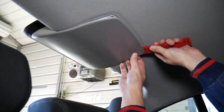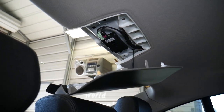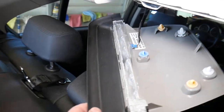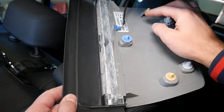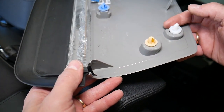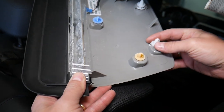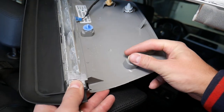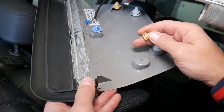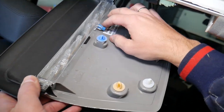Okay, one is out — all of them are out now. You can see right here: one, two, three, four, five clips holding that third brake light toward the roof. If you need to replace one of the clips if they break, you can just pull them out — those clips are replaceable. We'll have the link in the description below. Sometimes the clips will come off and stay on the mount, so you'll have to manually remove them after that.